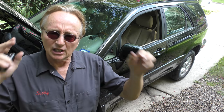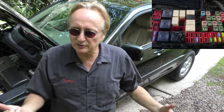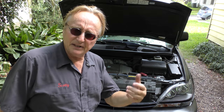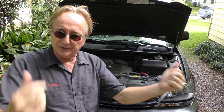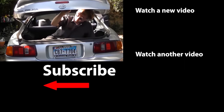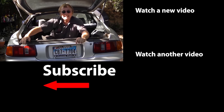As you can see, logic reigns supreme. Toyota and Lexus products often have many relays that are the exact same relay, so you can take them out of one thing and put them in another - in this case it worked, so we know that's the problem. The next time your lights start acting up and you find the bulbs are okay but they're not getting power, start checking out the relay system first, and realize they're all over the place. You need an information system like AllData to find where the stupid things are. If you never want to miss another one of my new car repair videos, remember to ring that bell!